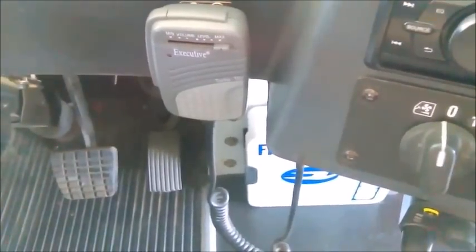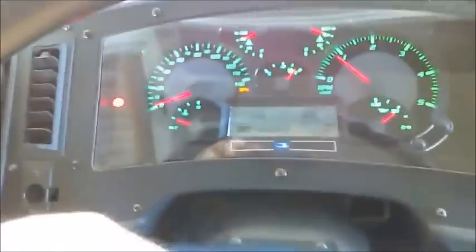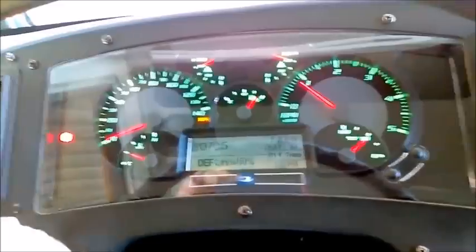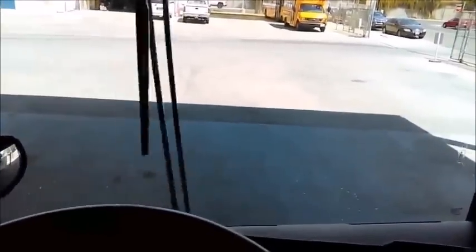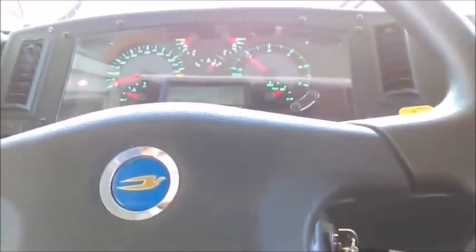I have my air horn. I check the steering column and steering wheel for play—there is good play in my steering wheel, and it also has tilt and telescoping though that's not required. My left and right turn signal indicators work. High beam indicator works. Hazard light indicators work. I check my wipers on three levels—one, two, three—and washer fluid, which must work. That completes the instrument panel, gauges, controls, and lights inspection.